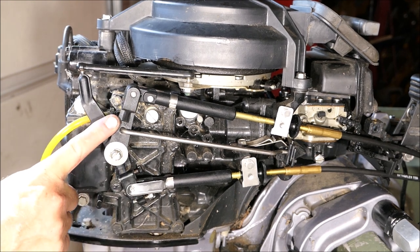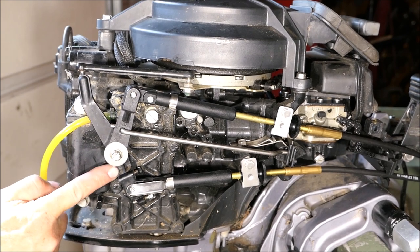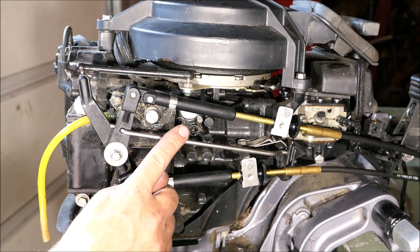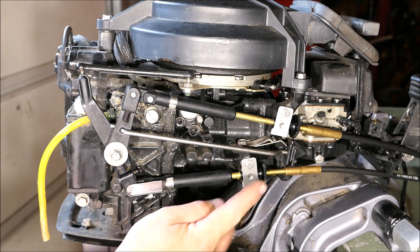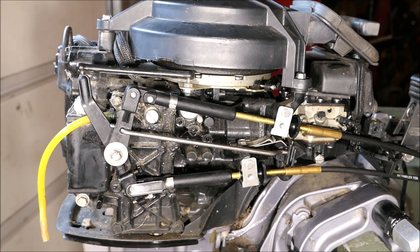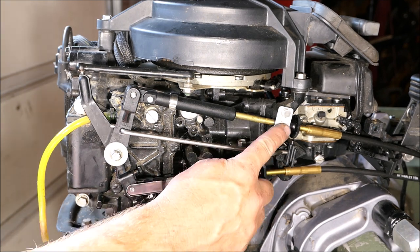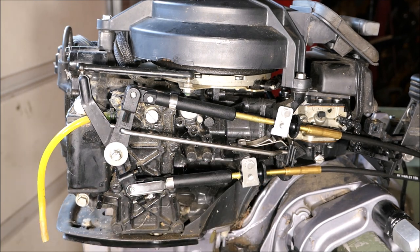This little piece was added right here, on top of the existing piece right here. The kit provided this rod, which goes from here to here, which is the shifter, and nothing had to be unhooked with the shifter. Other than that, I just installed the two cables, and it came with these two plates to install the cables, so it's a very simple deal, but quite effective.